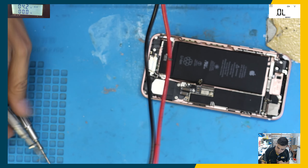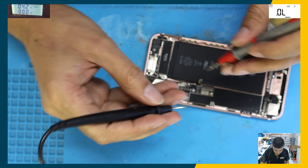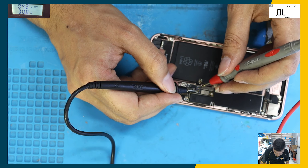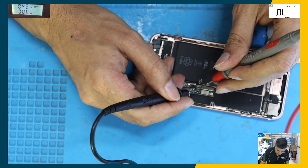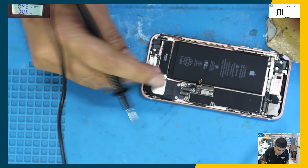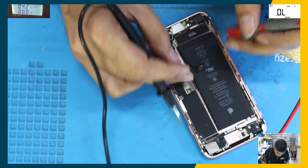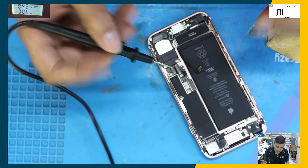Let's check VCC main — this is short. So this phone has a VCC main short. How we check the shortage on VCC: look at the DC power supply on the top left of the screen. Put positive to positive and negative to negative, and before pressing the power button it's already taking 1.3 amps, which means it has a short on the main power supply. That's probably why the battery is gone — the short is drawing all the voltage out of the battery, so it's not even taking a charge.